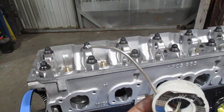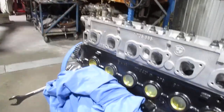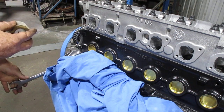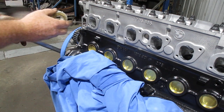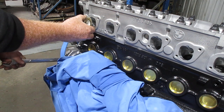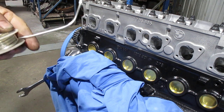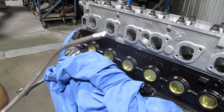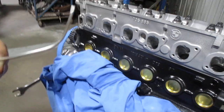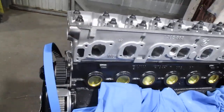Using 2mm soldering wire. Before top dead centre, place it into the quench pad and wind it over. You'll then have a flattened section of solder. This one I've already measured — it came up at 1.8 millimeters.